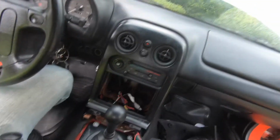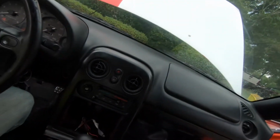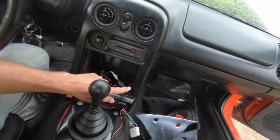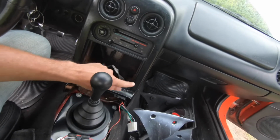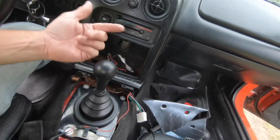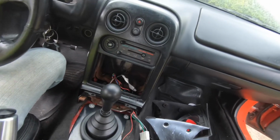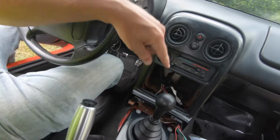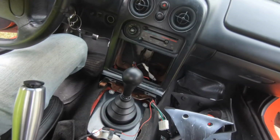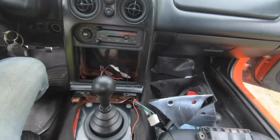What else have I got? I got a dash cover. It's not in here yet. It's in the house. New top. I got a radio on the way, and then I'm also going to put a USB charger here and an aviator. What are they called? Like the fighter jet switches with the toggle, the flip up cap, and that'll turn that off, because that particular one, I don't want it hooked up to the AC, because I'd like to use it when the car's off sometimes, but it's got a voltmeter on it, so it's constantly draining from the battery. Let me go ahead and turn this off.